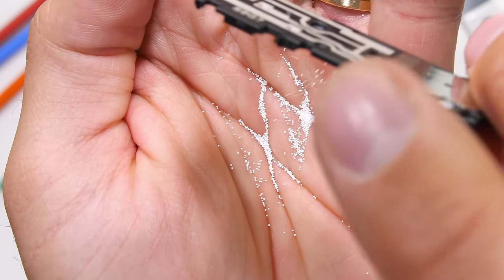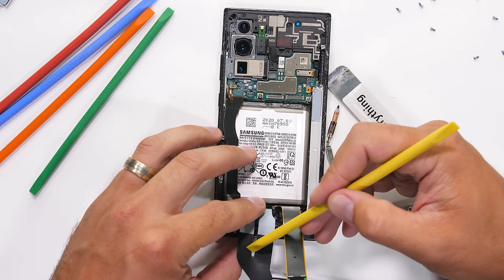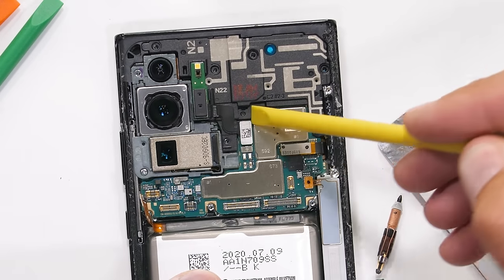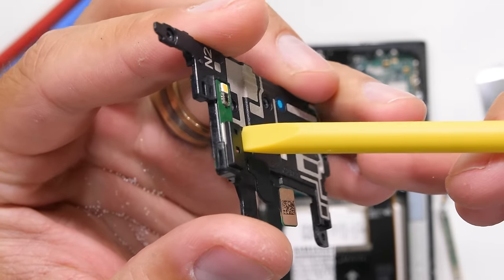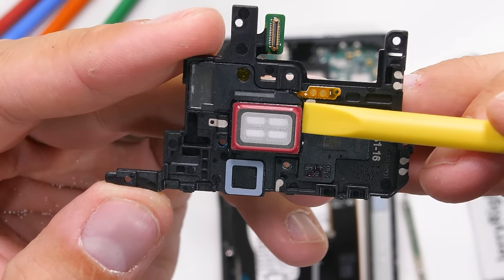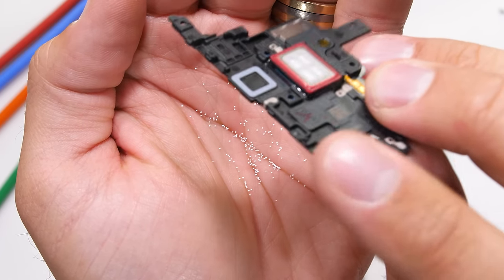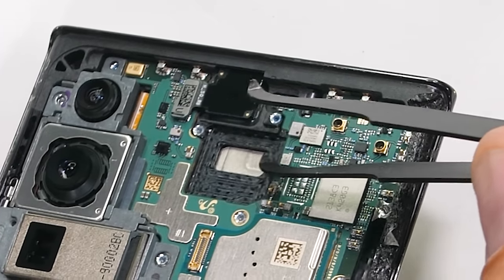Someone can count these little foam balls for me if they want — there are a lot of them, and I'm probably going to need a vacuum later. I'll remove the screen ribbon, just like a little Lego, along with the charging port ribbon and the bottom subboard ribbon. It's interesting to see Samsung do the same thing we saw inside of the ROG Phone 3 with the little raised internal boards. This one holds the flash and sensors for the rear camera along with the earpiece speaker, which is centered in the middle of the phone instead of all the way up at the top. It also has a chamber of its own little foam balls, so in theory the stereo sound from the Galaxy Note20 Ultra should be better because they have balls at both ends. You can see the little channel for the speaker sound that goes up to the super thin earpiece slot at the top of the frame.